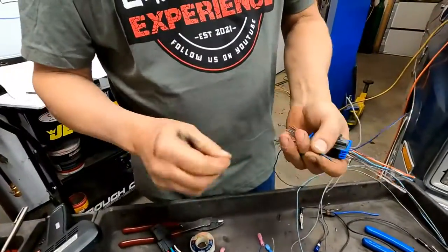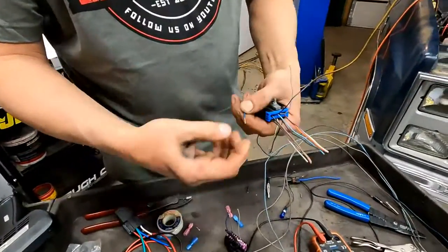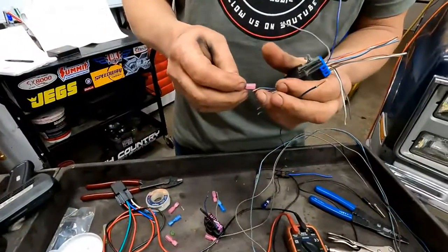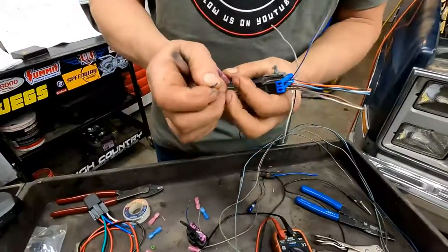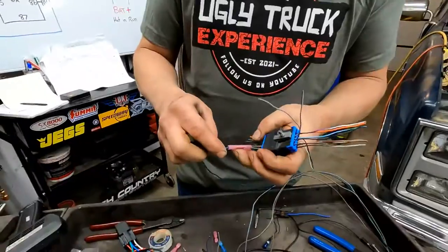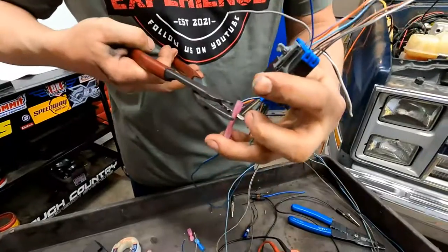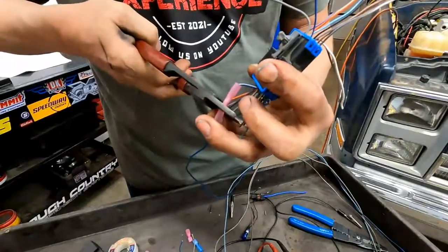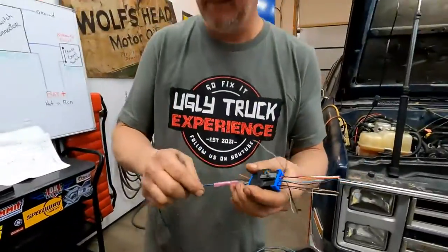These are 24 gauge wires, and then this is probably an 18. But these wires are going to be carrying very, very little amperage, so small wires are fine. The original wires that came out of the firewall for that truck were even kind of the same color. I could have almost used them, but they're pretty big and they're kind of brittle. So I thought I'd just do newer, smaller wires. May as well do it right, huh?